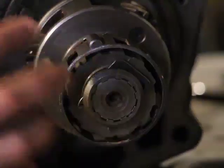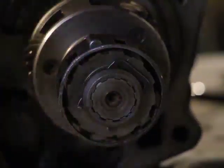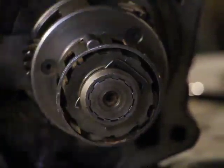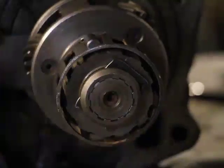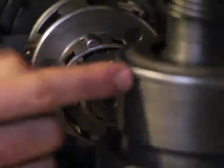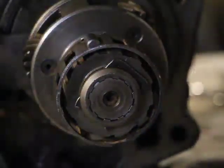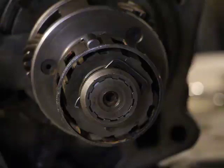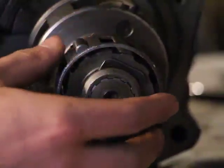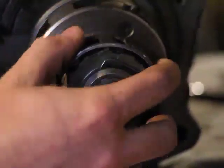But now, at the point where you let off the gas, the engine goes to an idle. Now the engine speed is lower, but the car keeps moving at that speed. So now this here is actually moving slower, and this other one here, this part, let me get the name here. Ring gear. The ring gear now is overrunning it, so it forces. It's going like this now.